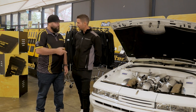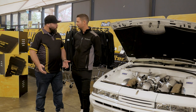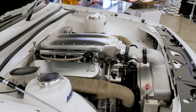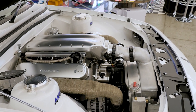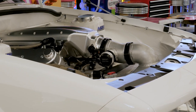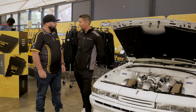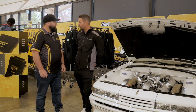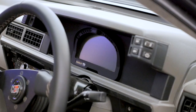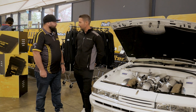Is it as fast as yours? Not yet — the car weighs a little bit more, and we've only raced it once. First outing the car went 8.1 at 173 mph, which isn't bad for a first run. A lot of these cars have big turbos up high, but we prefer to mount them down low to keep the heat out of the engine bay, and to keep them as subtle as possible since they're street cars. The turbos are actually hidden up underneath the front of the vehicle, with 50mm Turbo Smart wastegates underneath there as well. We make the power on full exhaust and race them on full exhaust. The interior was trimmed by the guys at Black Needle Upholstery in Sydney — one of the best trims we've seen. To make something look simple is the hardest job in the world.